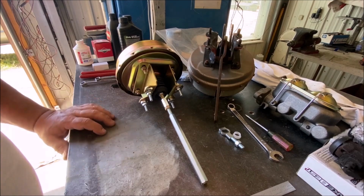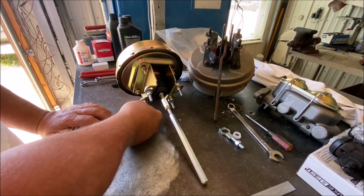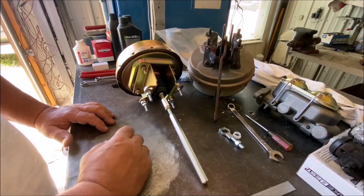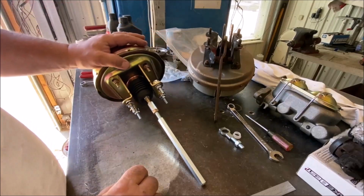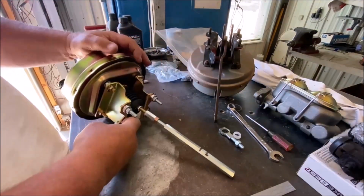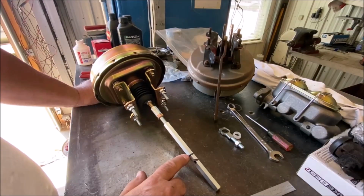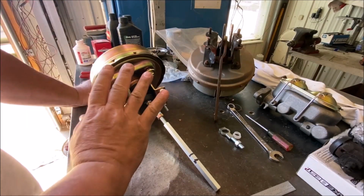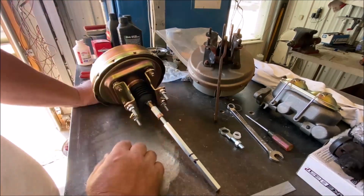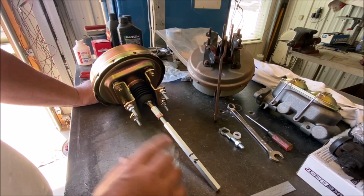All right, so this is how I pulled it out. This thing came loose. I didn't have that tight enough. This came loose. But this is how I pulled it out after you saw it in the car, okay? I marked it. Now, I made a mistake. When I marked it the first time here, since the pedal is not hooked to the brake rod, it just relaxes down towards the firewall. And when I made the first mark, I didn't think of that.